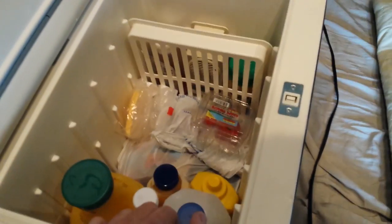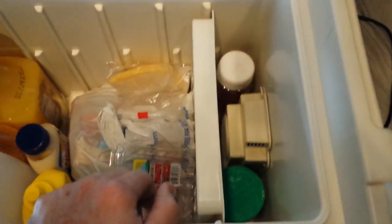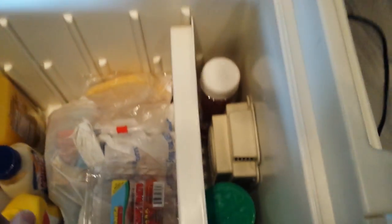Make sure the plug stays tight in the receptacle. On the inside, you can use this cooler standing upright or laying down — I choose to lay it down because I think you can fit more in it. It comes with a shelf. I purposely put this shelf in the highest slot you can, because it keeps things away from the air outlet. You don't want food and plastic bags up against that because you're blocking the airflow. The whole key to this thing is airflow and circulation — that's what cools it.